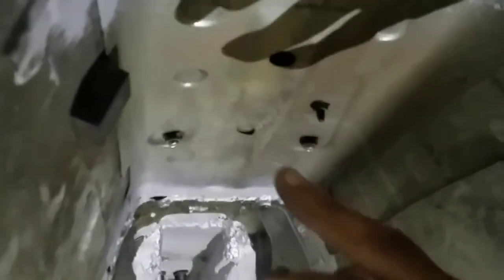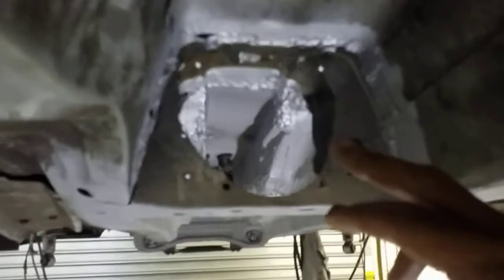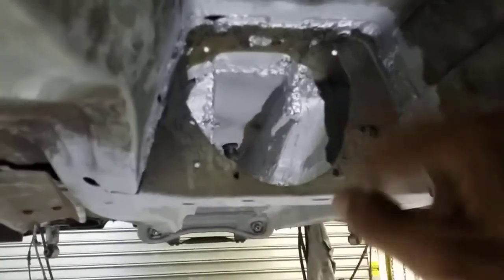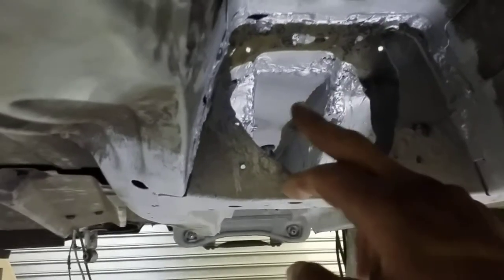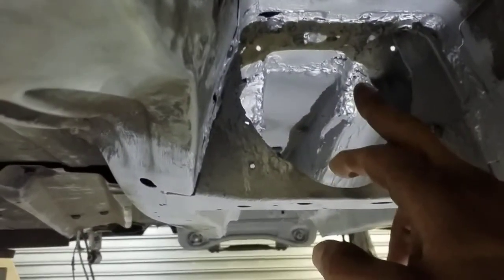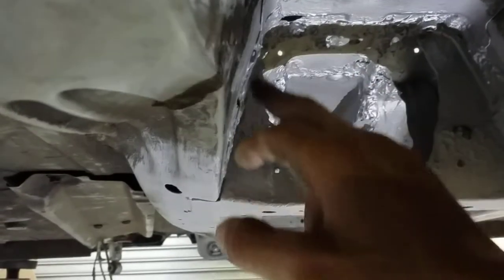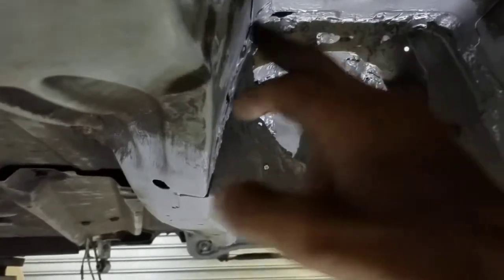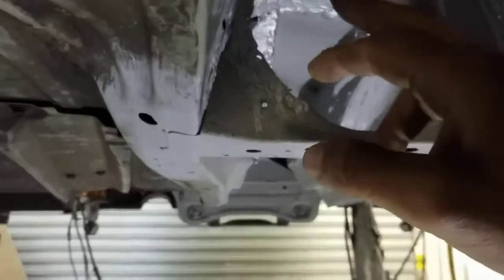This area over here you just need to knock it up a little bit — the metal is quite soft. Then you get to the center where you've got to cut a hole. My previous prop used to sit dead center, but now because of the DSG box we're moving slightly over to line up with the box, so I just had to recess it out more to the left for the center bearing carrier.